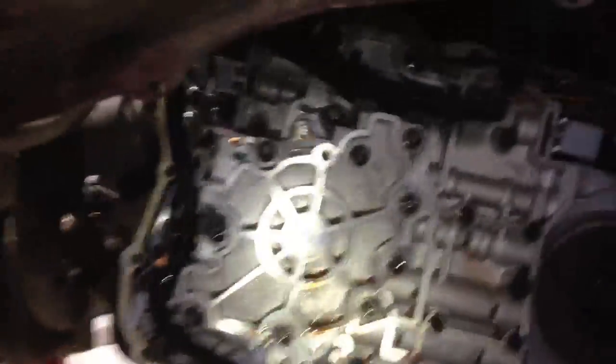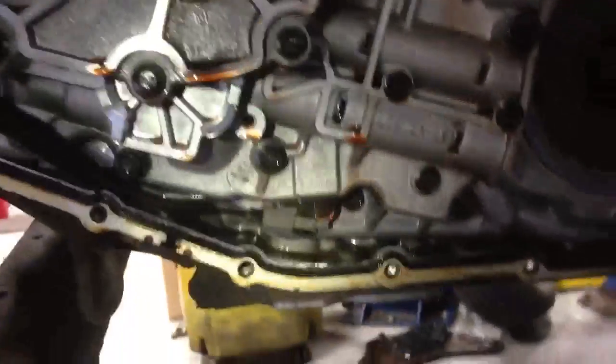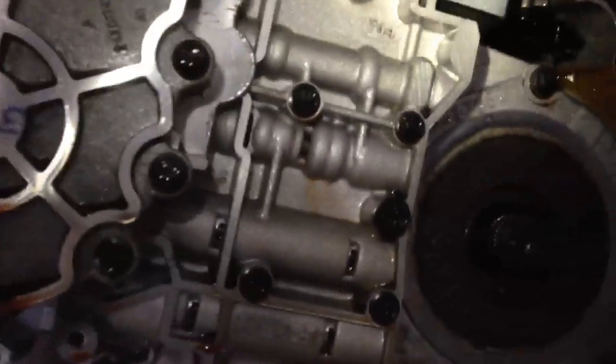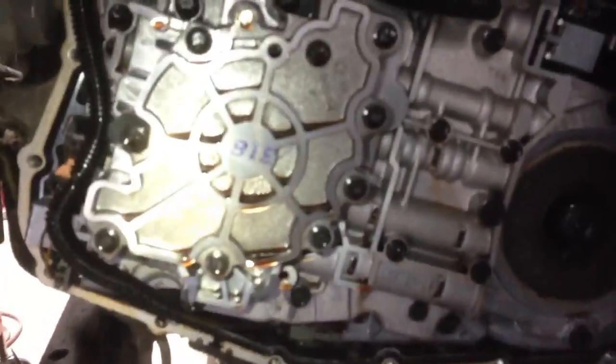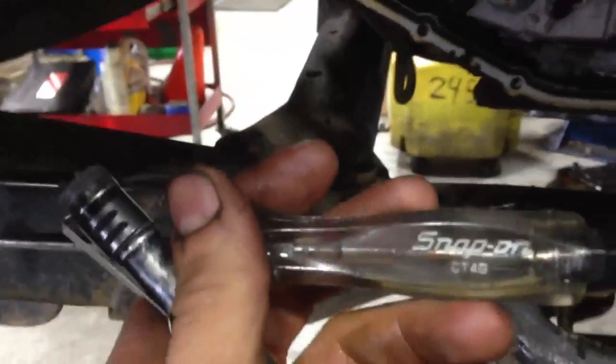And it's easy to work on. You're going to have a bunch of bolts to take off here. You're going to need a T25 Torx, 13 millimeter and 10 millimeter to get these off. The four Torx are down on the bottom here. There's one 13 that goes right here and another 13 that goes right up there. The rest of these are all 10s. Now once you get the side cover off, you're going to want to take a test light here and connect it to a good ground.